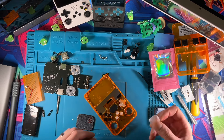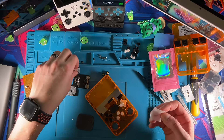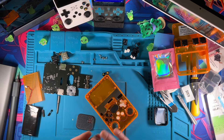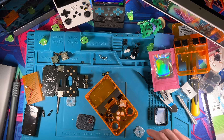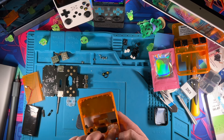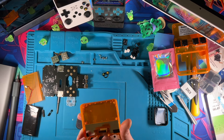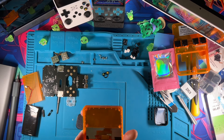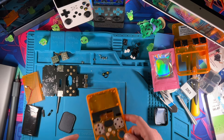Sakura doesn't want you to wipe directly on their buttons, which is somewhat understandable. My big thing is actually just cleaning up these membranes more than anything else — making sure they are all nice with no stickiness. This is brand new so it should be just fine. This isn't a normal alcohol swab — it's actually an anti-adhesive one that just gets all the glues and stuff off. I like doing it just because I like to know that everything's clean when I put it all back together again. Get your three posts to line up and we have everything in there — that's looking pretty fancy.